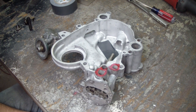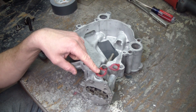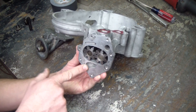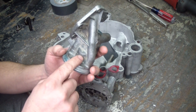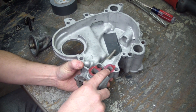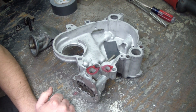In studying the old AMC oiling system I'm pretty much amazed at how many 90-degree turns the oil makes. You've got the pickup in the sump of your oil pan, and from there it makes a 90-degree turn into the block — that's one. Then from here into the gear housing, that's two. Out of the gear housing, that's three. I'm not even going to include the filter — all cars have that — but out of the filter you have a fourth 90. The cover back to the block is a fifth 90, and actually right in the block is a sixth 90 to get back up to the oil gallery.